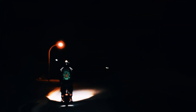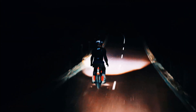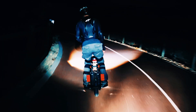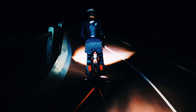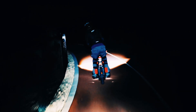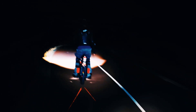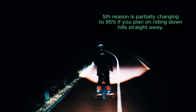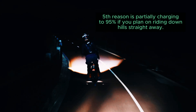The fourth reason is that most of the latest smart BMS wheels — like the S22, the V13, the Xtreme, or the Lynx — all begin balancing around 80% of the max voltages. For the older wheels and scooters, it's true that they don't balance to the top end voltage, so it's a good thing every 20 cycles or every month to make sure they're fully charged up. The way I tend to do it is I put my threshold voltage up a little bit — so the smart charger enhancer isn't going to kick off at exactly 126 and not charge all your cells. I put it slightly above by about a volt or two, and that will allow the charger to balance all the cells needed. This is how I do it and it seems to be working fine after all my testing.